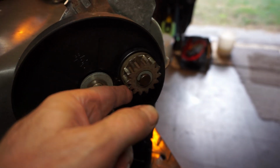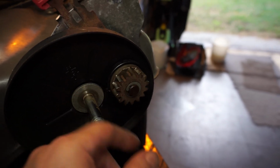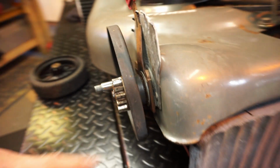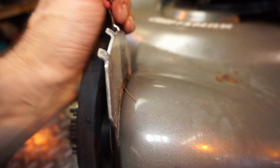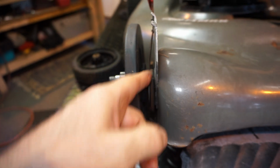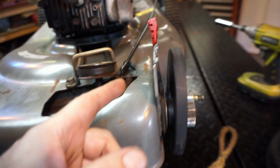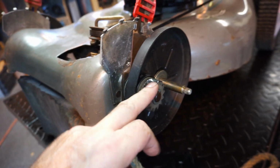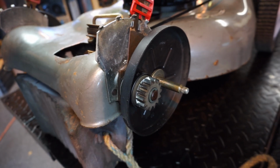It's like mint. Right, so I'm gonna put a little oil, a little spray wax in, because usually I put oil in. I may put a little oil on this side here, because we got to get these adjusters to work. So that's another, yeah, that's a little stuck. So we got to put a little oil in here. Sometimes I use my tranny fluid mix to start off with to get everything moving again. And then I think in here we're gonna follow up with some chain wax. These guys are in really good shape.